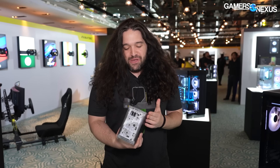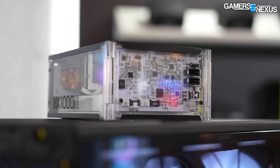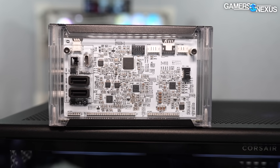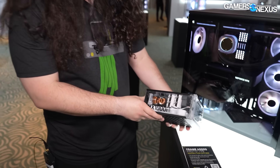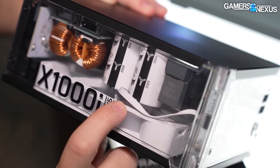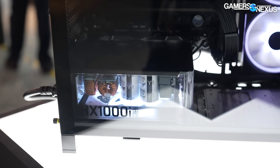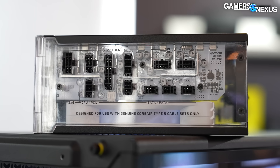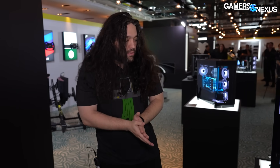The challenge is plastic is an insulator — incredibly good at insulating. If you've ever touched a free acrylic sheet, you might get some static electricity, ESD, or it could cause EMI issues. So it's contending with potential ESD but also losing some shielding you'd get with steel. They're basically getting it certified for the acrylic sides, which is why we haven't seen a whole lot of this. Corsair has customized the caps and PCBs for nice color matching — I think the solder mask was customized as well. The white PCB looks pretty nice. If you have a case with a visible power supply area it would look great — it's just a question of when they get it certified and what the extra cost is.